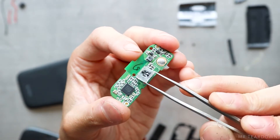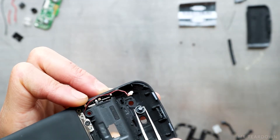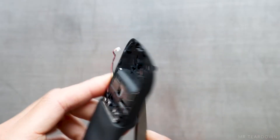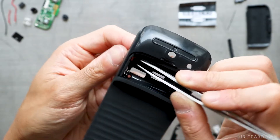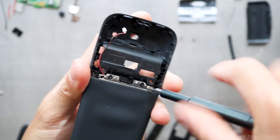The optical components of the infrared sensor and the Bluetooth button can be removed. This black piece of tape covers a hole so that the PCB will not be visible when the battery cover is open. I also removed the four battery terminals from the housing before finally moving on to the bending mechanism.